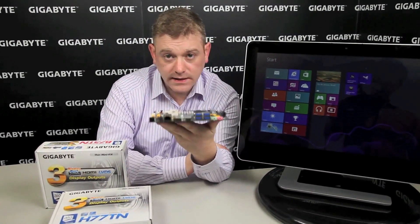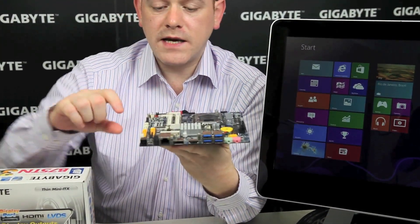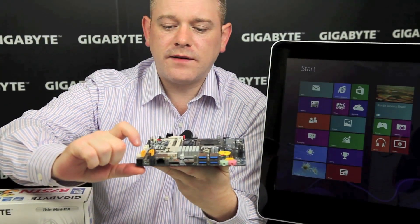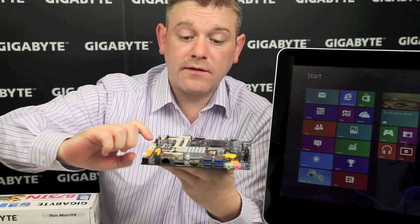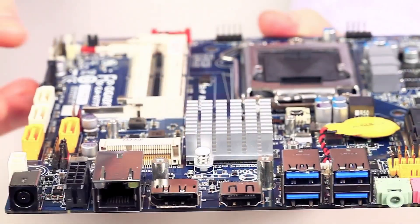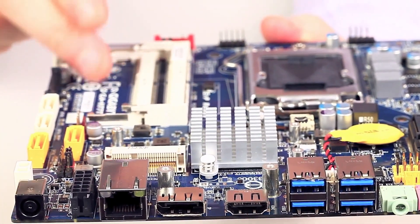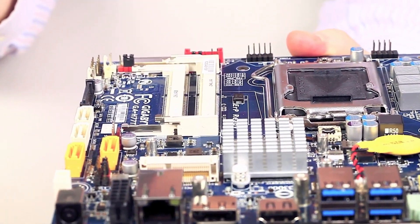These are all based on the thin mini-ITX standard, which is pretty thin. It's all based on a 2.5cm height limitation for the back panel I/O, which also dictates the same level of thinness for everything else on the board. So instead of having regular full-length DDR DIMMs, we have two SO-DIMMs that lie flat on the board.